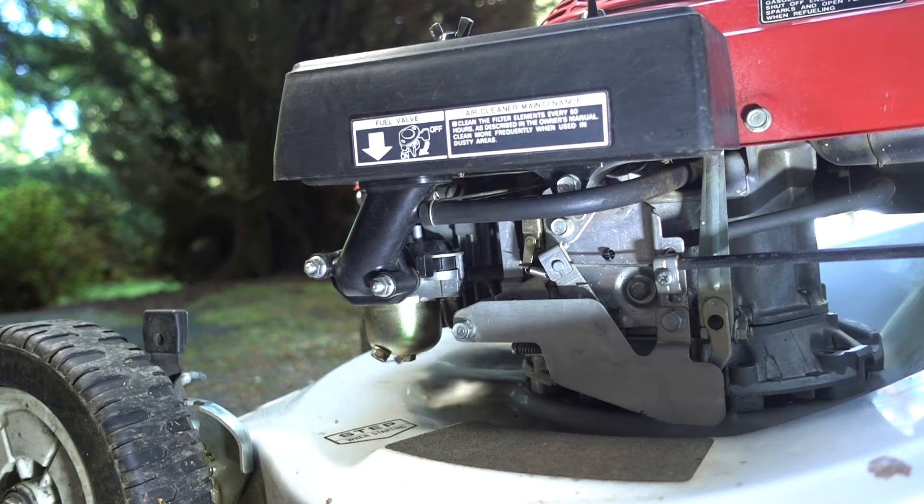I know it's getting spark, so I'm pretty sure it's a carburetor. There are three 10-millimeter bolts to remove to get the airbox off of the intake portion of the carburetor. The good thing about rebuilding carburetors on these lawnmowers is you usually don't need parts — it's usually a matter of cleaning. If you need any gaskets or O-rings, it's probably because the original was torn.